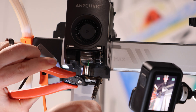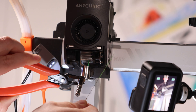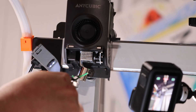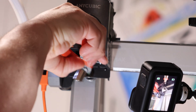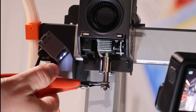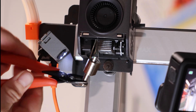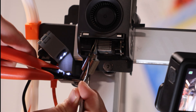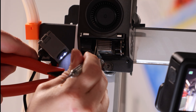When you bought it, the kit did come with a needle that you can run through the nozzle to get any leftover filament out. I had a little bit of green here which I thought was clear, and it wasn't — so we did have plenty of filament to actually clean out. If you get an issue printing where it says 'broken filament detected,' this is what you need to do: it needs to be hot, you need to use pliers, and you need to remove this nozzle and clear out that filament. I've run into this many times since I've had this printer.